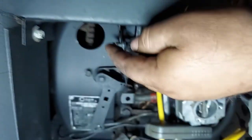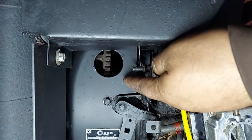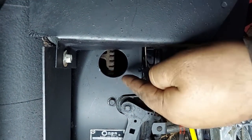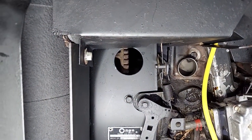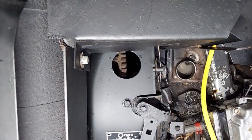So this is how you adjust your timing. The white line that's on the flywheel needs to line up with the white line on the gear case cover. The timing light is going to show you where it is, and I'll open and close the points — hopefully you'll see that white line moving back and forth, advancing and retarding.